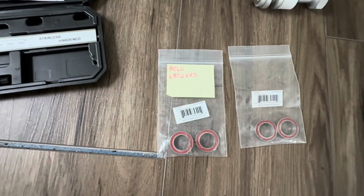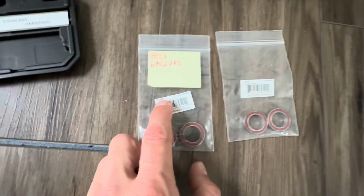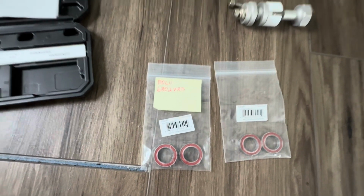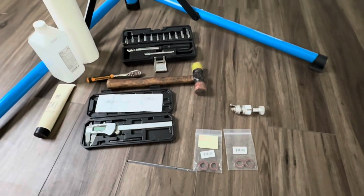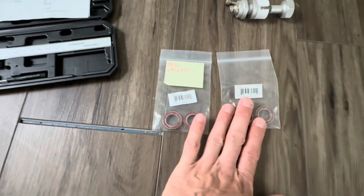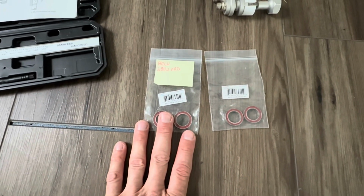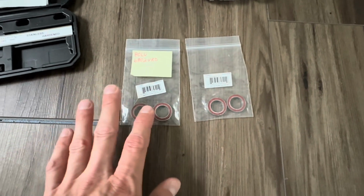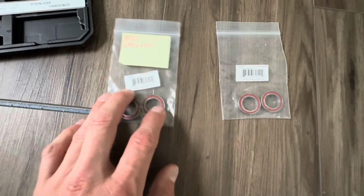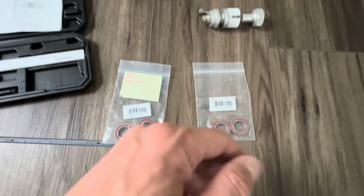I do not know if these are the best possible bearings that I can put in the bike. However, the part number is the same as what's in the manual. And whenever I get it taken apart, if the bearings are still good, then maybe that bearing is good enough. I bought these off Cannondale Spares, and it does say 6802 times 2, so each order has 2 bearings. Just to be sure they'll order 2, so now I have a backup.